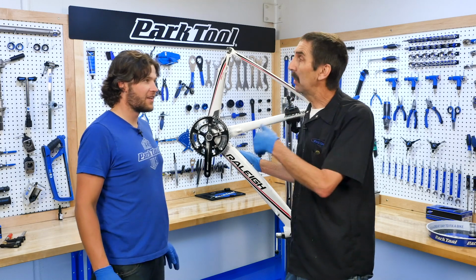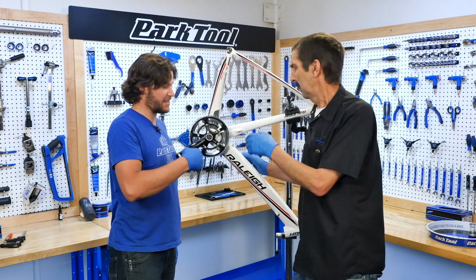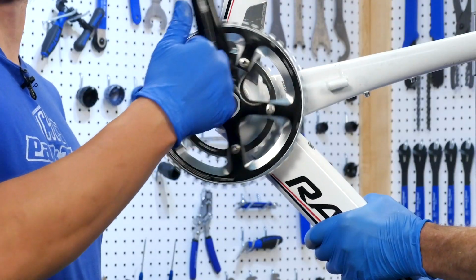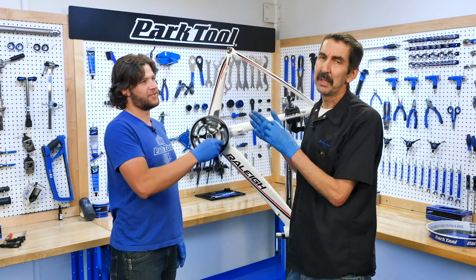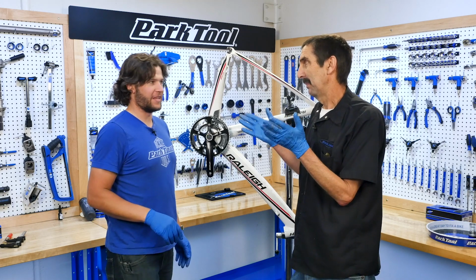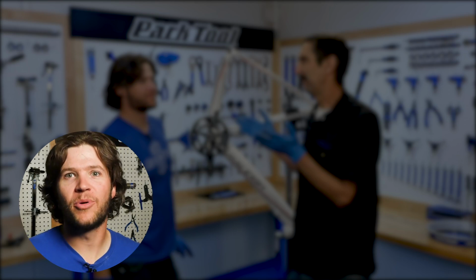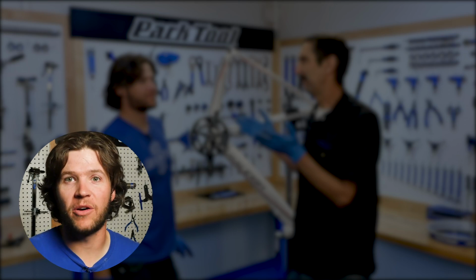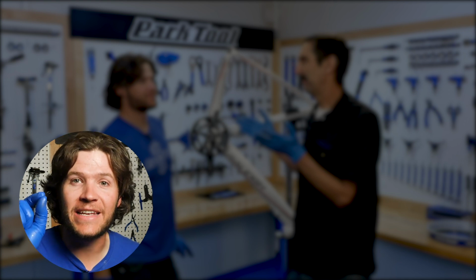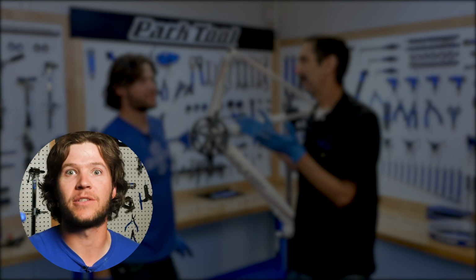But again, how about with time? With time, I think in about 15 seconds, this is going to be bad. I feel something. These bearings are already ruined. There's minerals, literally minerals inside the anti-seize compound. So everyone at home, do not, I repeat, do not put anti-seize, anti-seize compound, copper paste, in bearings, bushings, or any dynamic surface on your bicycle. Do not.